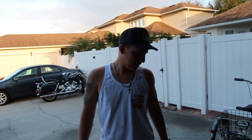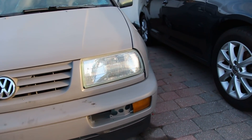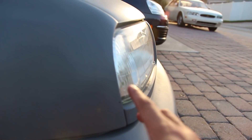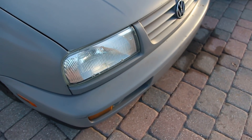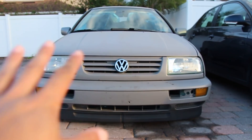What I'm using as a reference for my headlights is actually the Jetta truck over here. We got even and even on both sides, and up top we got even gaps right here and right here. Come to the side — you can see how the grill strip comes right flush, and the headlight is in a nice even line. I can't even put a finger in there, everything's right inside. This is my reference — the goal is to have the front of my car look as even as this OEM car.